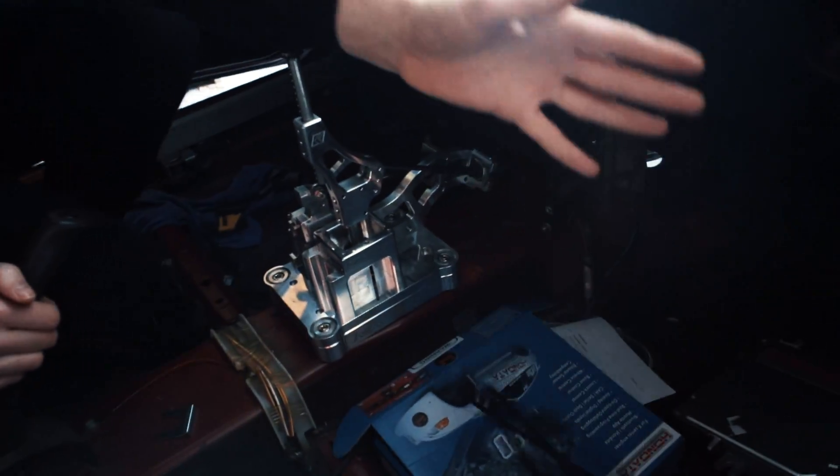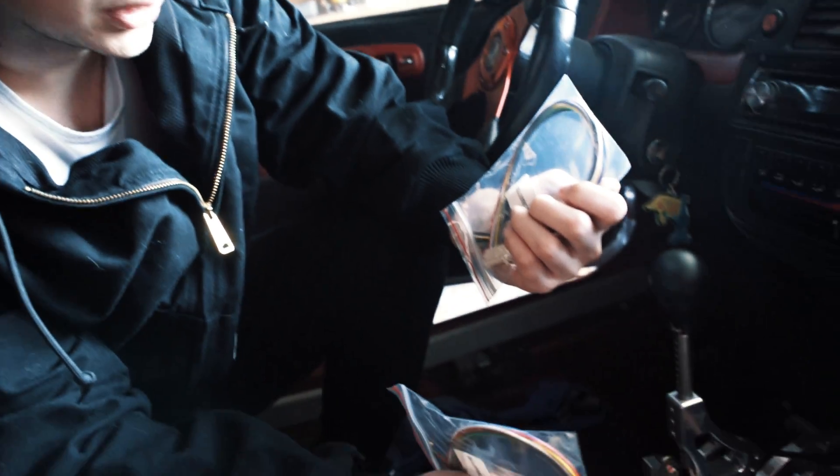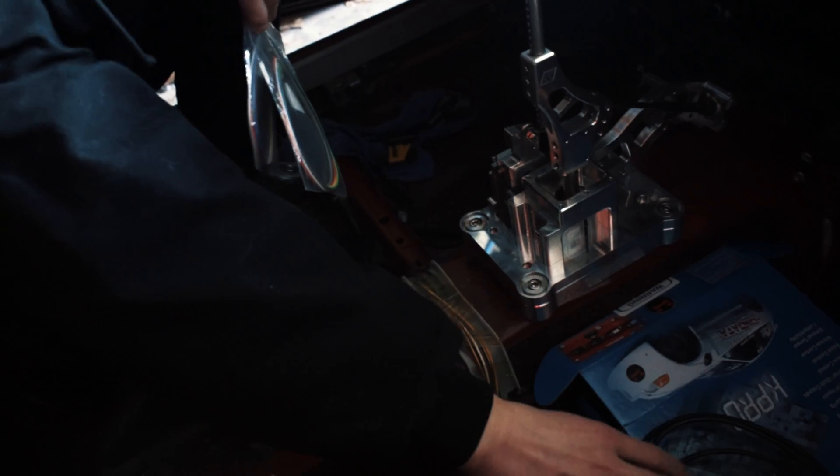Just like that — it's done. You'll plug this into your laptop for tuning. With the K-Pro you don't really need some of the extra stuff; I just need this cord. I need to find a better way to mount it, but at least it's in the car. The conversion harness is all labeled — fan switch, temp switch, O2 sensor. The secondary O2 sensor is wrapped up and I'm not going to use that. I fed it in through where the stock harness comes in and hooked it all up.